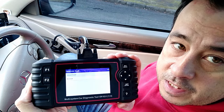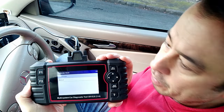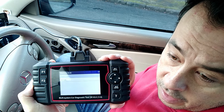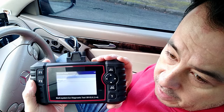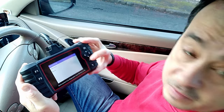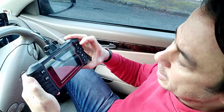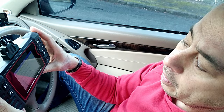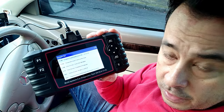Now we've got two options: Smart Scan and Manual Scan. The Smart Scan will scan all of the available systems that the iCarSoft can talk with on the car. But if you know the specific area you want to go to, you can hit Manual and go straight into it. Smart Scan might take about half a minute or so. I'm going to select Manual and select an area where I had a problem with the parking. I think I know what the issue is - I've resolved it now - but there may be fault codes still on the ECU, the car's computer, the electronic control unit.